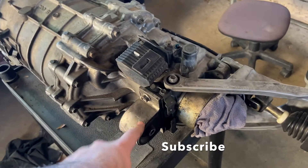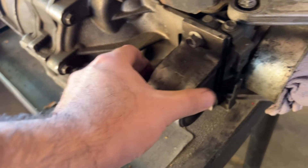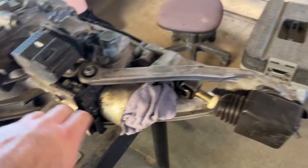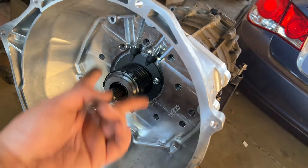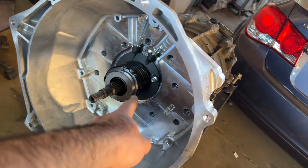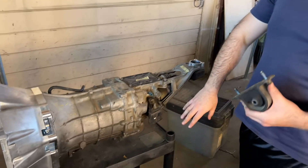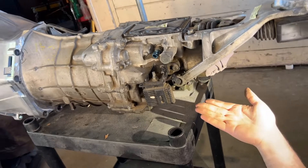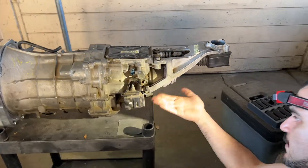One of the modifications is for the transmission mount. I've heard I need to cut something off of it, but I'm not really sure exactly what piece. We also have the shifter to work on, and we have to install the bleeder holes and the master cylinder holes for the 256 slave cylinder. We managed to take off the transmission mount — it's just two bolts — but I don't know exactly how much material to cut since the driveshaft goes in here, so I'm going to pause and wait until we install the transmission to see how much I have to cut.